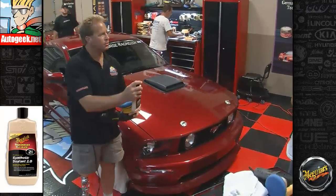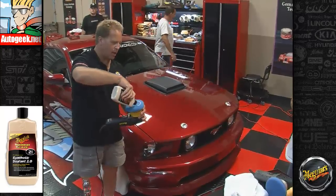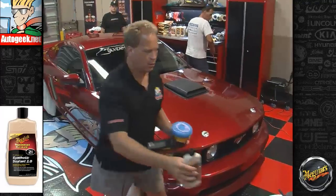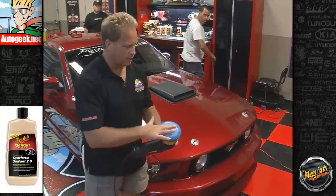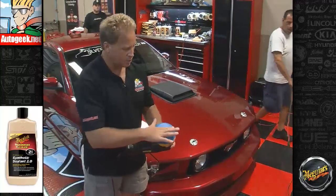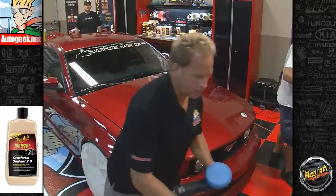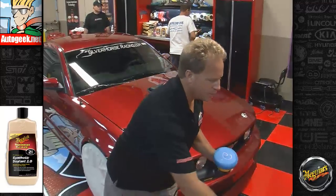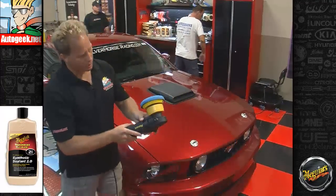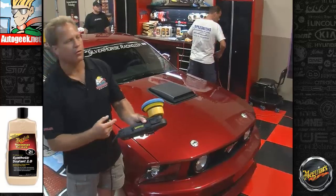So next thing we're going to do, John, is we're just going to put some of this right onto the pad. Okay. And since this pad is brand new, I'm just going to spread this around. That way the entire face of the pad is lubricated, dampened with liquid synthetic sealant. I'm going to put a little bit more on. And for this, the most important thing to remember is turn your speed down. Okay, so that was on 5. I'm going to bump this down to 4.